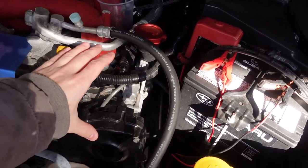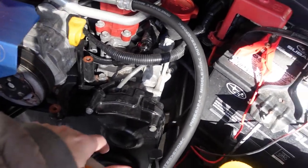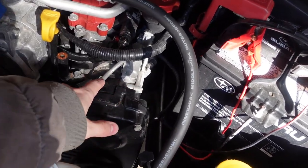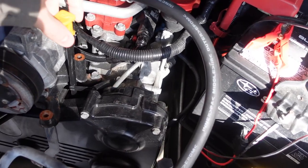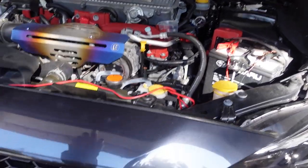Starting this off, it's honestly not too bad. My car already has the secondary pump deleted — it's this big plastic black thing that was right here, so I don't have to worry about it. If you still have it, you'll need to remove it to access that 10 mil for your oil dipstick, which has to be free and out of the way. You'll also want to drain your oil first. Tool-wise you don't need much — a 10 mil, three-eighths, probably a pry bar, and I got a scraper from the dollar store. I'm going to try my best not to remove the headers.